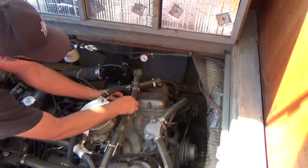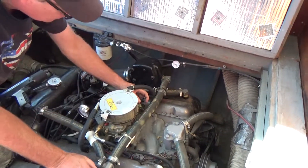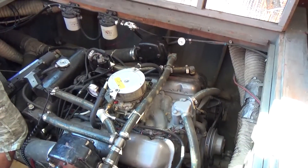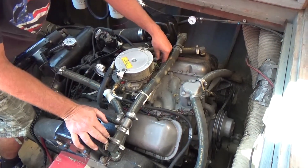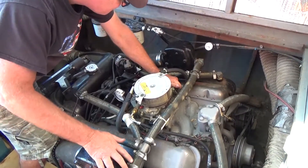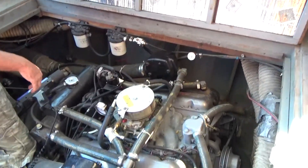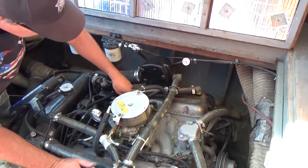Okay so indeed we did have a timing problem and the timing was at 8 degrees. When we got up to 2,000 RPMs, because this engine does not have any advance control on the distributor, it was popping. So that's been corrected — we went ahead and changed the advance up to 12 degrees and that should take care of the popping.